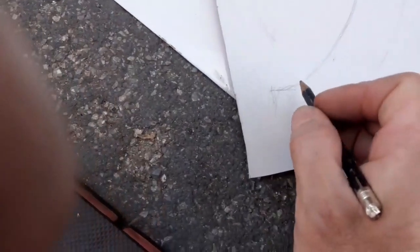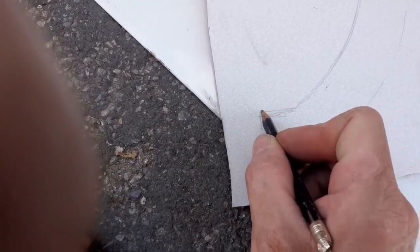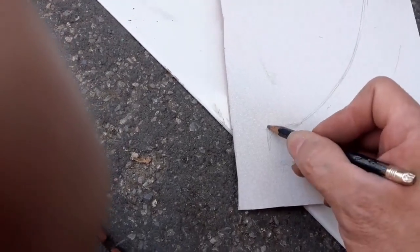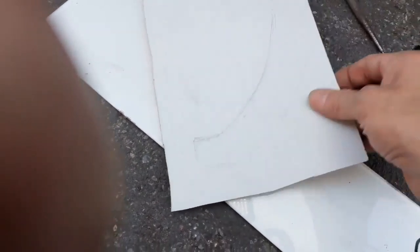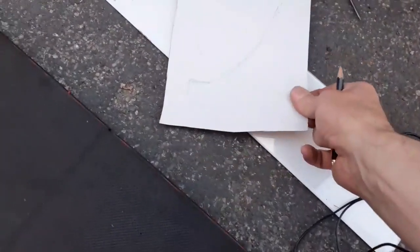This bit here is completely flat from there right the way along. So realistically I'll end up replacing this and probably the curve to about there. It's not going to be a massive repair, but it's going to be very long — about a metre long. I'll turn the camera off here, trim that out with a pair of scissors, trace it onto a piece of steel, and cut it with snips. I'll see you next time.